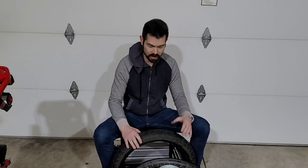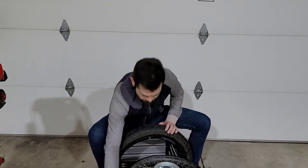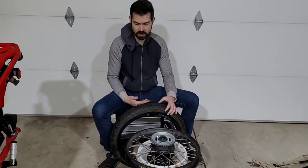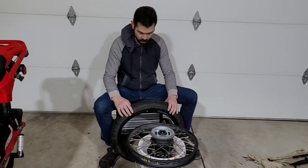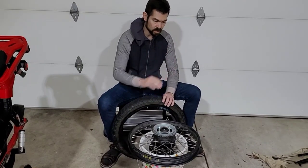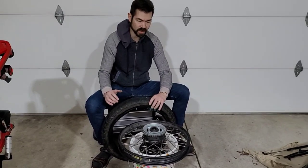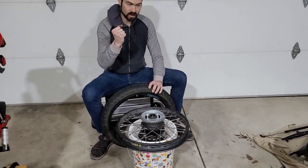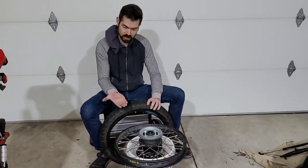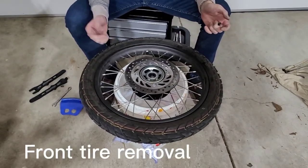So what did we learn on taking your first tire off of a motorcycle? Number one, 5-gallon bucket. That works really, really well. I was very pleased with that. If you have a nice stool or something to sit down on, you can take your time, not worry about the world. Second thing, these rim protectors, I think for the smaller wheels, one rim protector for that first couple of bites, and then using your Motion Pro tool, don't try to come in at an angle, try to come in almost parallel to the direction you want to go, and it'll be able to catch underneath that tire rim. I don't know about you guys, but let's go ahead and start round two.